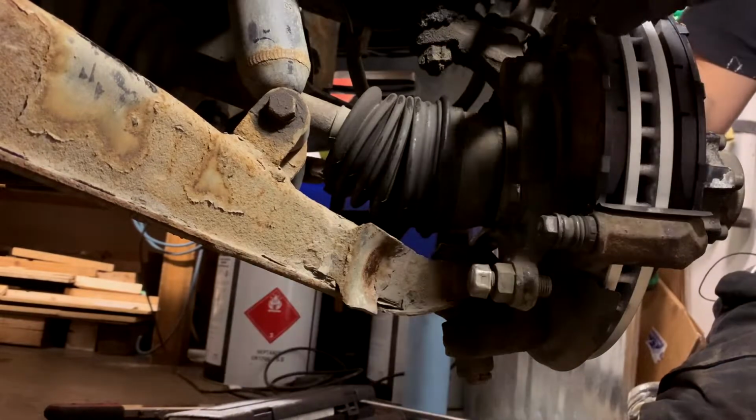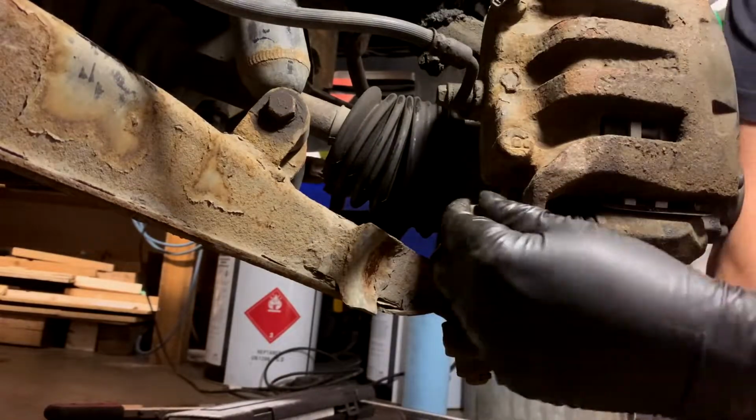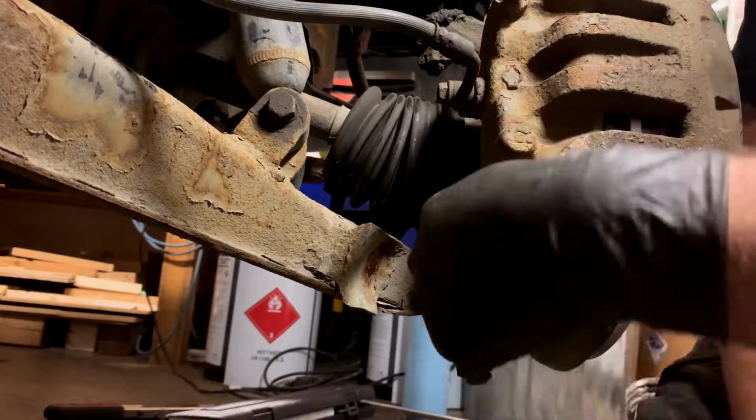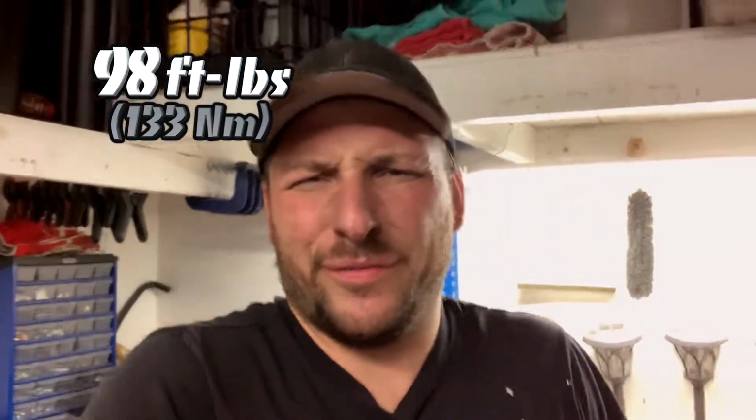And you take your guy, put him back in, and you close him down. Tighten that down. And you're good to go. That's how you replace the front brakes, right? All you gotta do now is tighten up the wheels you got on there and torque those, obviously, probably to like 80 or 100 foot-pounds, something like that.